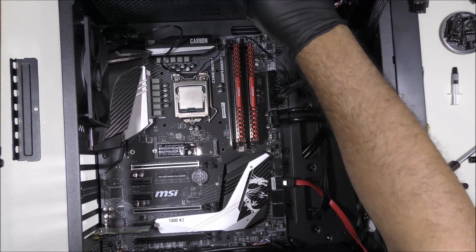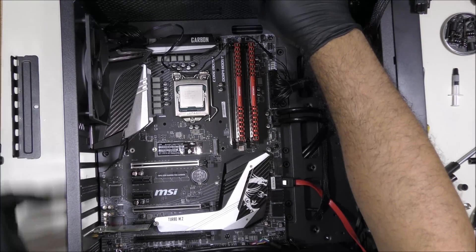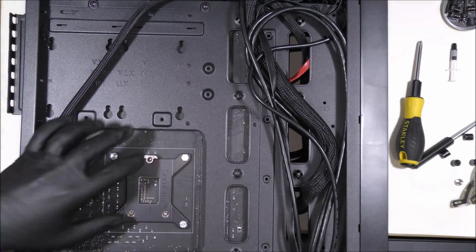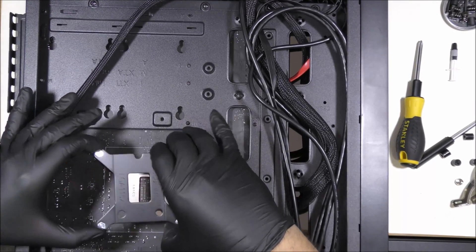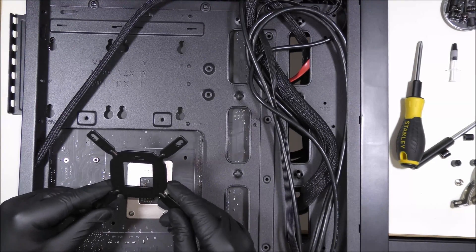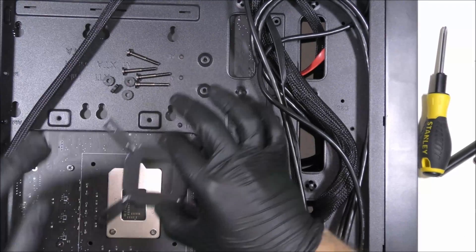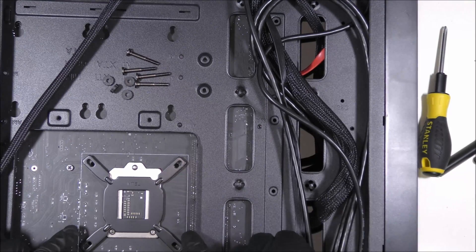Slowly we're going to lift our computer, release the back door of the desktop case, and remove and reinsert the brand new bracket. We're going to remove the back panel so we can release the old mount or bracket. This is our old mount bracket, and this is the new Intel bracket we are going to install. I prefer that you first put it on your CPU socket from behind to make sure you know which holes it's going into.